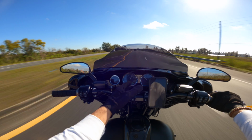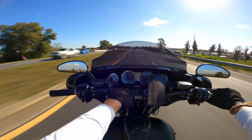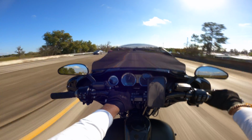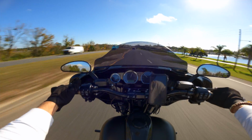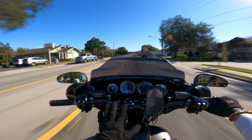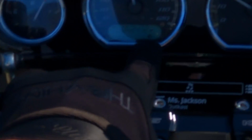Well, when I'm in 5th gear, it shows here as 6th gear, which I'm assuming is because of the overdrive in the Baker Grudge Box is probably what's causing that to happen. Okay, so as you can see here, right now I'm actually in 5th gear. I'm not in 6th gear. This is what it's showing for being in 5th gear right now. It's showing me 6th gear indicator.